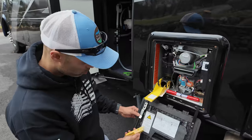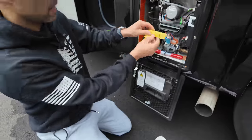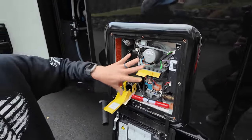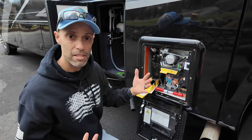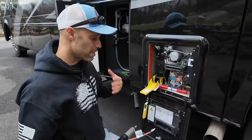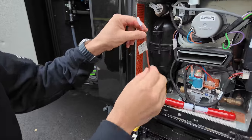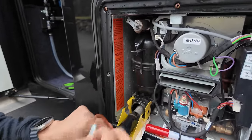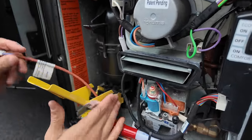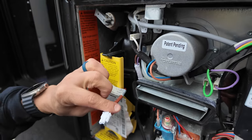This latch is just to hold the cover here. When you're not using it, you hold this cover — it goes right in there. This cover is going to go right in this part so when you're going down the road, it's blocking air from flowing in there and freezing anything in there. Obviously, when you go to use this unit and fire it up with propane, you've got to take this out because this is the exhaust for the propane. So the next step: take your new filter with the heated element, put it in the inlet with the wire side up. Make sure your O-rings are good because that's going to give you a good seal so no water comes out. Then close it — be careful you don't get your fingers caught. Lock it in, and this wire is going to come out to the side. That's step number two.